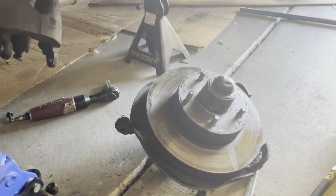I just set the spindle on the bottom and I'm jacking it up a little bit. I lined it up at the top. I'm just going to keep jacking this up so I can thread the ball studs, and then we're going to put this thing back together. They're just finger tight on there right now, but I released the jack — they're threaded on pretty well. Everything's moving and working. I'll probably clean off the rotor — there's a lot of oil on it.